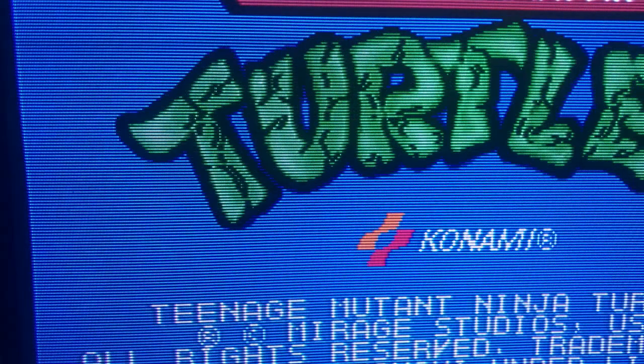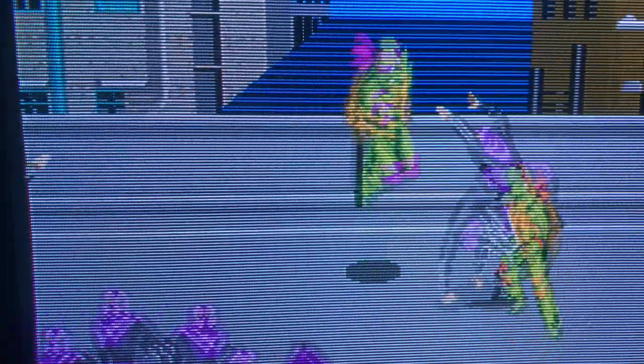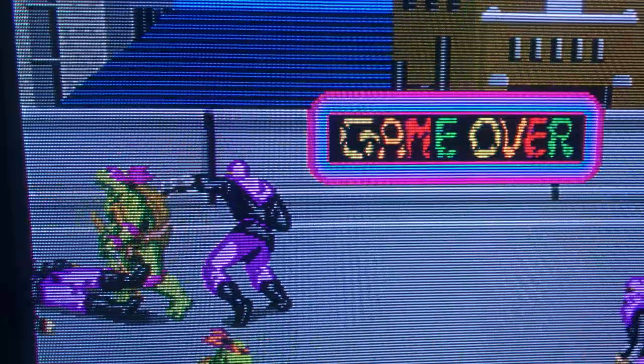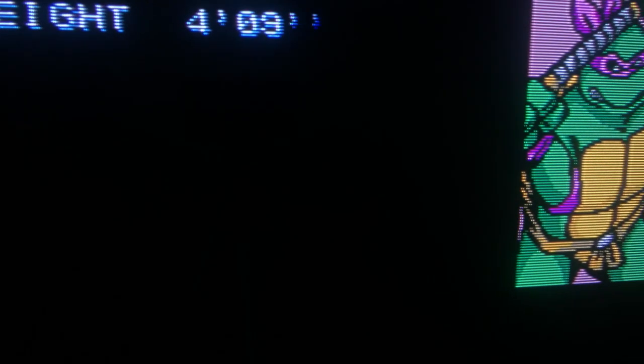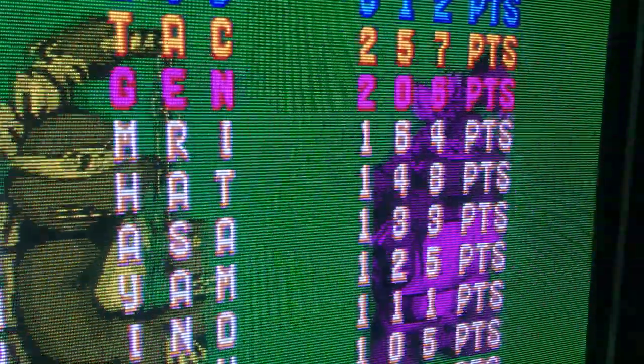These are arguably one of the best consumer-grade CRTs ever made. The Trinitrons are very sharp compared to other consumer sets, and the colors are very good. These sets are over 20 years old, so one thing to bear in mind is how faded the tube is. If it's a faded tube, the colors are going and the white balance is going to be off, so finding one with low hours is something you want to look for.